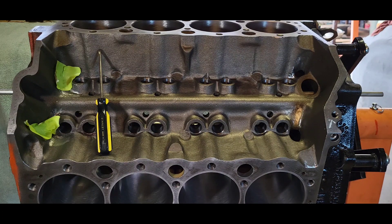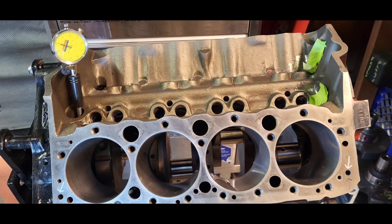The lifter galley holes are along the axis of this rod and are 0.725 inches down the lifter bore, so you're going to have to measure them at 90 degrees to the rod axis, like the screwdriver is positioned. Using our dial bore gauge, out of all the lifter bores, none were over 0.8435. That limit is the diameter of a small block Chevy lifter — 0.842 — plus a thou and a half clearance equaling 0.8435. So that's good news. We'll have the machine shop check it behind us to be sure, but I think it's a go.